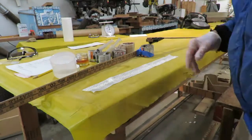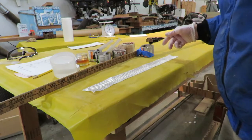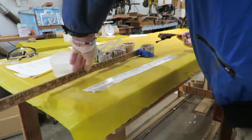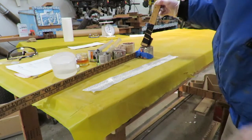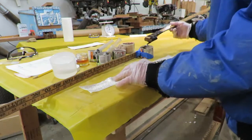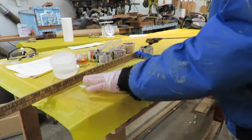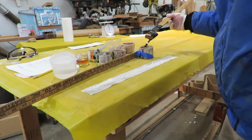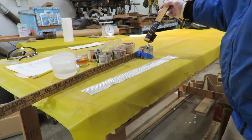Okay, here we are. We've mixed up 6 large marks of resin with 6 small marks of hardener, and we've mixed it up in our mixing pot that's on our yardstick. And so it's right here. First step, we've cut our fiberglass tape to 22 inches long, but we just measured that length inside the boat with our yardstick to see how much we needed to reach to the front from the fiberglass tape we already put in on the center line. We're working on the center line.